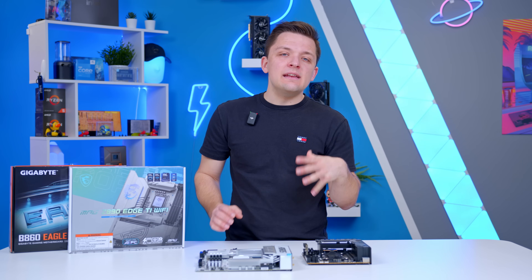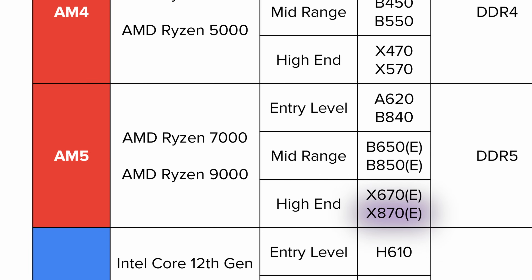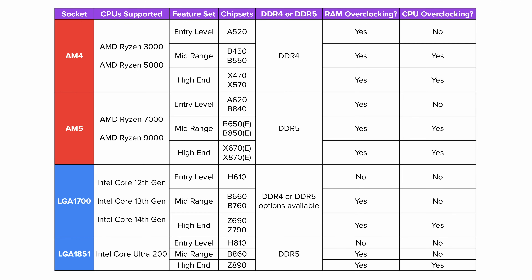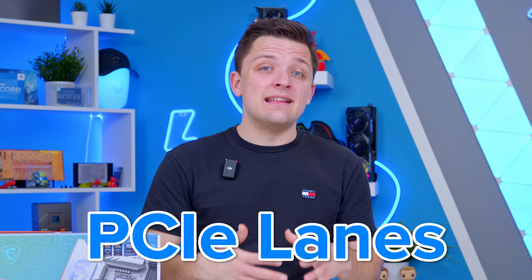Once you've determined the motherboard you need based on the required CPU socket, you're then going to want to look at chipsets before deciding on the exact model. AMD have three tiers: their high-end X870 and X870E boards, followed by B850 and B850E, and finally the B840 chipset at the bottom. Historically, higher-end chipsets were differentiated by PCI lane count and overclocking support. AMD have turned that on its head a bit — their X and B-series chipsets both support CPU and memory overclocking. Intel, on the other hand, requires a Z-series top-end chipset board if you want to overclock the CPU and RAM. The big differentiator with chipsets is PCI lanes, bandwidth, and features.